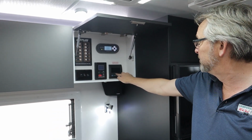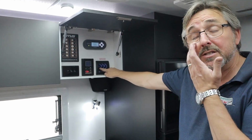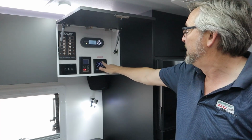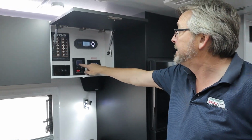These are your tank gauges, showing that we're full on. Showing we're full in your fresh tanks, they're on the right, and then your grey tank is on the left, flashing red at us. So we know it's fundamentally empty. They're not as good as you hope they are in reading how much. You're probably closer to 95 in both of these tanks, and about 10% in there, but I'll crack him open so it is physically empty.